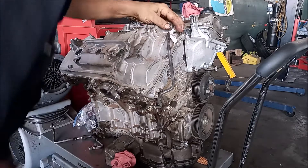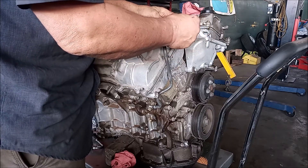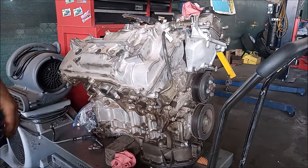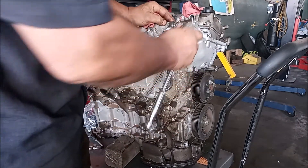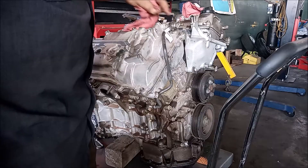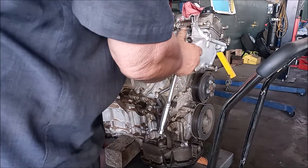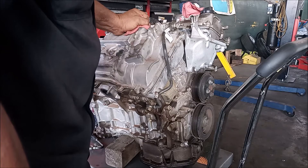Do the same thing on the top side — you would have both banjo bolts and just thread each banjo bolt in by hand. You need both copper gaskets on both sides. When you have these snug, you can tighten them down, and the correct torque for these bolts I'm going to include in the description. That's it for how to replace the line. Of course, you have the option to put the plastic cover back on or leave it off. Thank you for watching — I hope you've enjoyed this video.